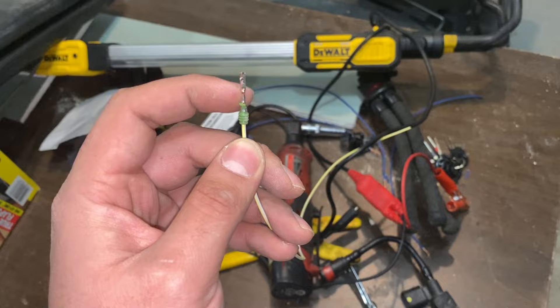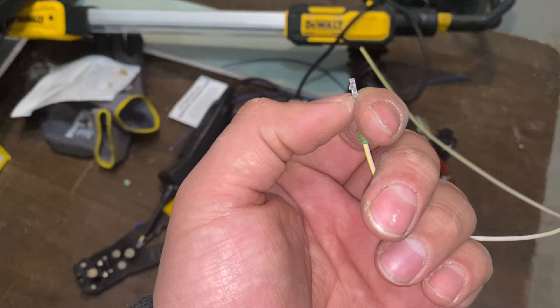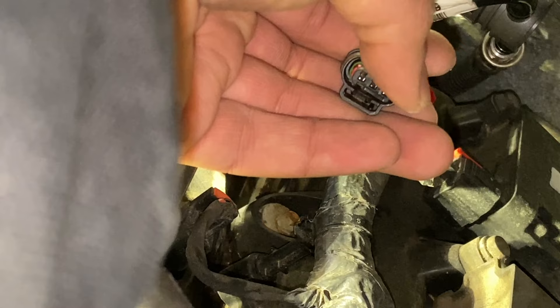This is what the end of the pins look like. There's a side that has a groove on it — the side with the groove will go into this connector, and the groove will be facing up this side. So the grooves are all inside this connector. Before you push the pins into the connector, you've got to take this red locking tab.